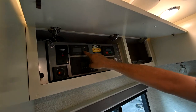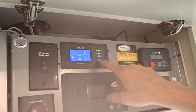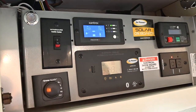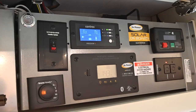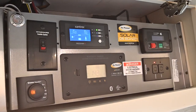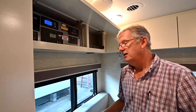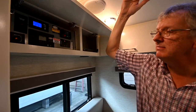I'm going to show you the inverter. This is the inverter control — when I want the inverter on, I push in that button, the on/off button. If I'm just sitting here and I don't have shore power plugged in or I'm not running the generator, I can turn that on and run my TVs, satellite equipment, some outlets, and my microwave — so I can dry camp off the batteries for a while. The house batteries charge a bunch of different ways: plugged into shore power, off the generator, when you drive down the road, and off the solar panel mounted on the roof.